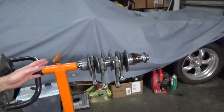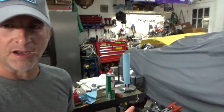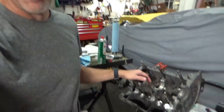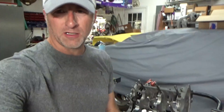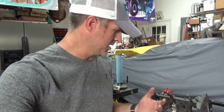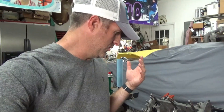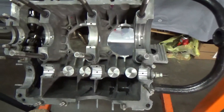Where I left off, I got this crankshaft all ready to go — cam and all those other good things. I just had this case bored out for a little bit bigger pistons, so we're gonna put some 90.5 piston and cylinders in there, and ended up boring out the heads as well. In the last video I explained that I was probably going to have to do some clearancing because we're going with a stroker crank, and that is quite the case here.